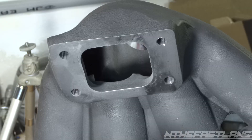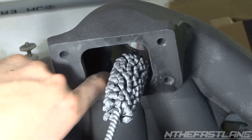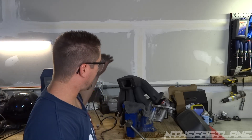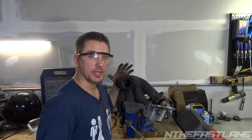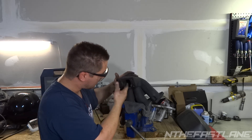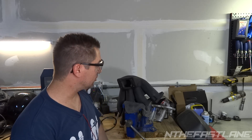Here's a close-up — it's really smooth, and this is just 80 grit. I'm gonna drop it down to 180 so it'll be even finer. Now I'm gonna smooth out the casting by coming in here and going all around it, trying to work through the back where the wastegate is, and just smooth everything out all around. You guys pretty much get the idea. Go ahead and port it out with the 80 grit and then swap out to the 180 grit and give it a nice finish. Make sure you get in here and try to get all the rough casting out and it should be nice and smooth. You should gain a little bit of flow — there's just no way around it with the casting slowing your flow down.